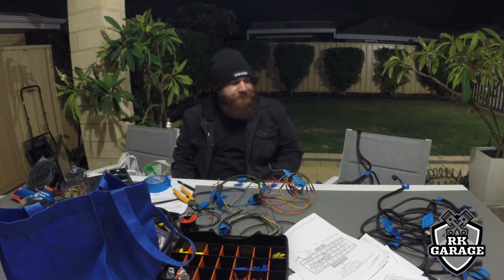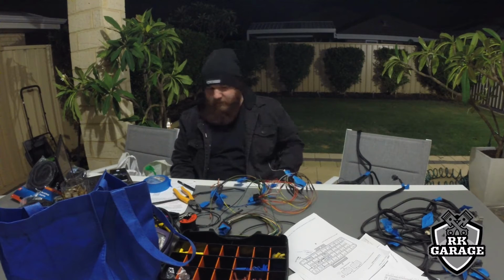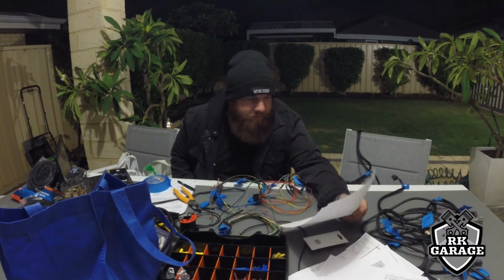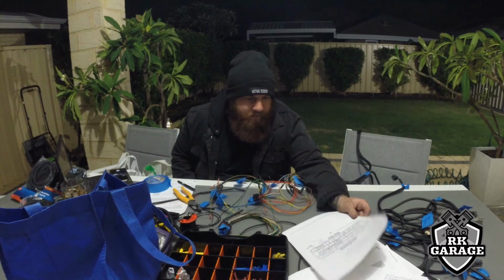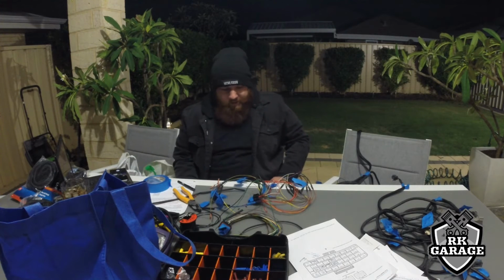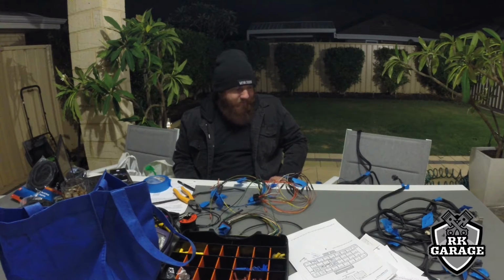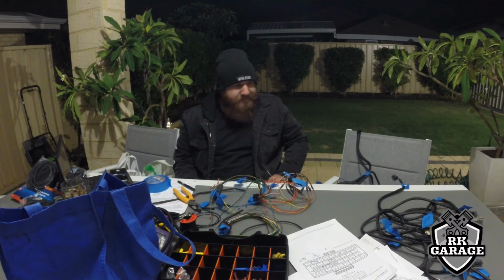Alright, refilled my drink, going to get on to the coils. So, I think, what can I do? Ignition 1 to 4 is on this alarm. I don't remember what I said in the previous videos, even though the last one was yesterday. I remember I found out that the plugs on there, well, the LS3s were the same as L98, LS2 and LS7, so I'm going to just hunt down any 6 litre coils, so I'm just going to wire them in. Is what it is regardless.